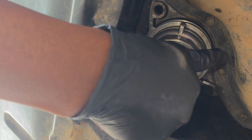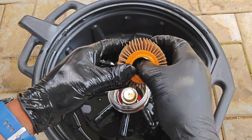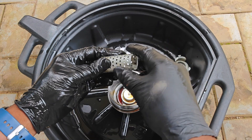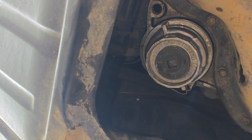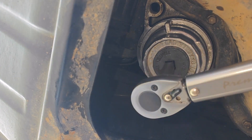I made this video because you may have a car that uses these kinds of oil filter housing designs. Just make sure that the center tube doesn't get discarded with the old oil filter, which is what I think happened here. Also, if you don't change your oil yourself, you might want to verify that your center tube is still in place.